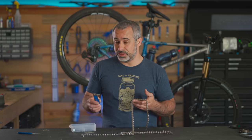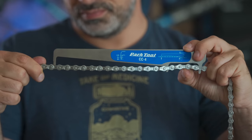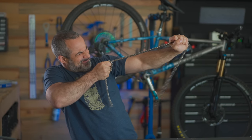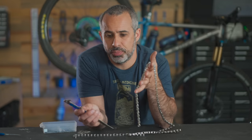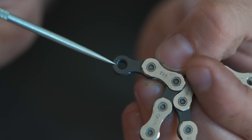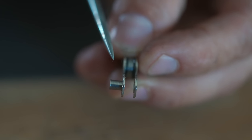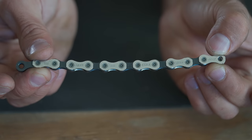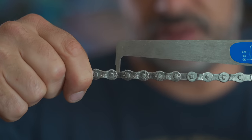If you've been in the game for a bit, you've probably used a chain wear indicator to see how much your chain has stretched out. Is your chain really stretching? It's not really incorrect to say your chain stretched, but it's not actually stretching. It's those little pins inside the rollers getting sloppy and moving around more, causing the illusion of stretching. Your chain is worn out and it's time for a new one — it's not actually stretching, even though it is technically getting a little bit longer.